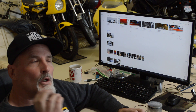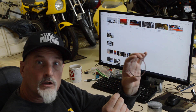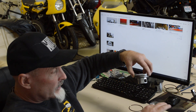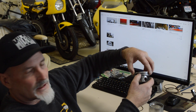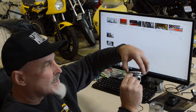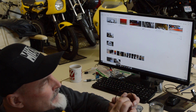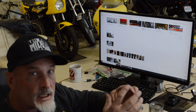Going back a video or two, remember that I didn't get the stepped rings back from the chrome plater, so I used a regular pin ring. The pin I put in — since the bottom of the piston lock screws up into it — has to be above this surface, so it's about ten thousandths into the dome of the piston, about ten thousandths past the one millimeter point. There's about a ten thousandths gap between the bottom of the locating pin and the top of the ring surface. What I found with this ring — and you can't really see it — is the locating pin started to fret against that shoulder that locates the ring.